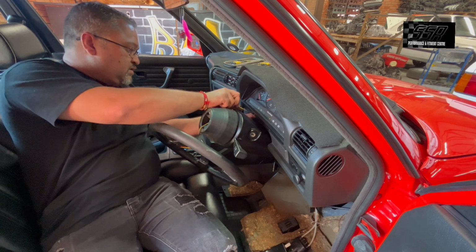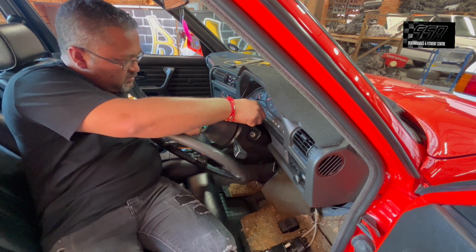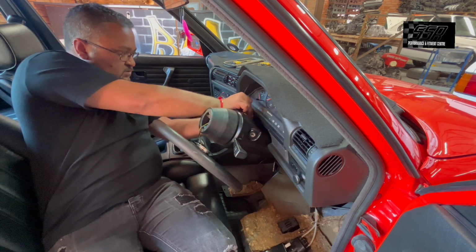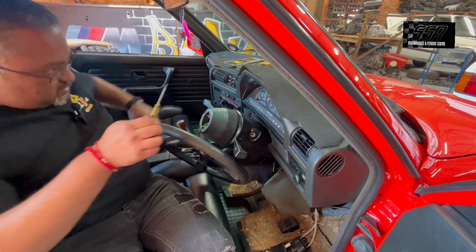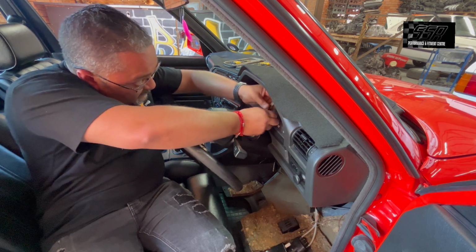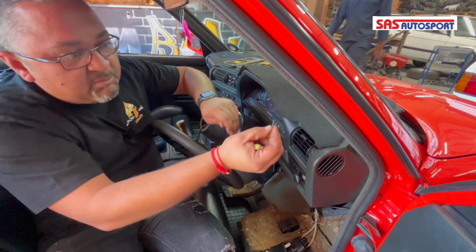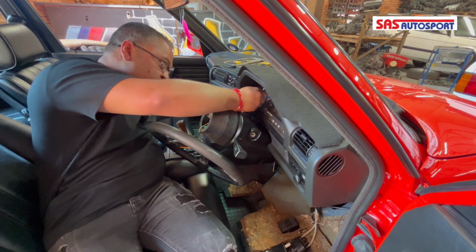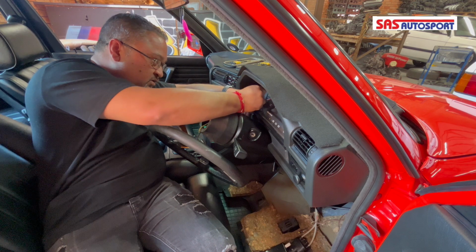See, so this one is out already. It looks like it's stripped out on the cluster itself. So for three small gears, we've got to go through this whole process here. But you'll find that, especially if your car is a driving car and I won't say everyday vehicle. Okay, these are medium lengths, right? Also black heads. These are the top ones here. If your car is a driving car and everything is operational and functional, the stripped gears will actually irritate you to hell and gone.